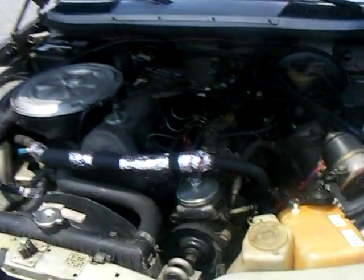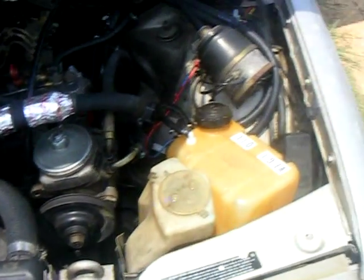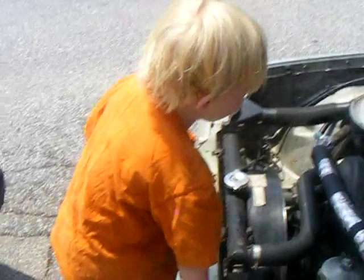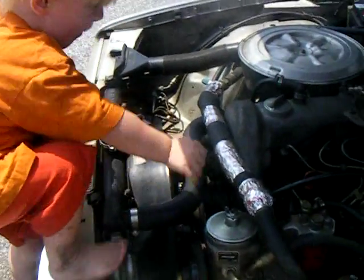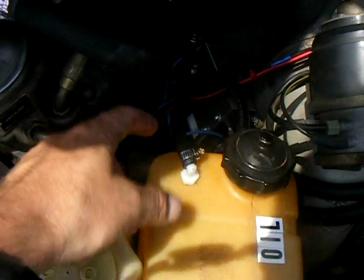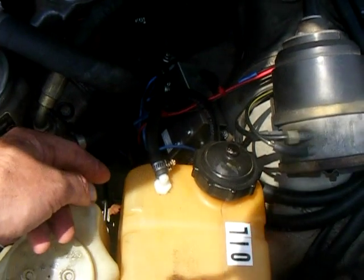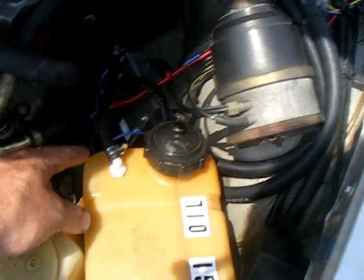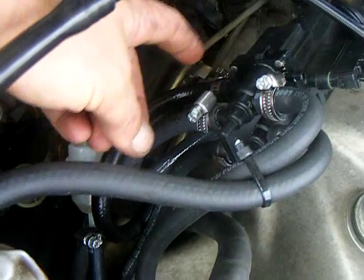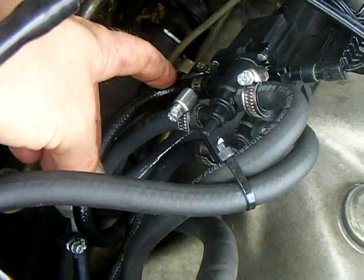I read a lot on YouTube and other pages about converting diesel to vegetable oil and it looks pretty simple. I'll show you details. I put a small tank from another vehicle that has vegetable oil in it. There's the vegetable oil tank — that is the return line and on the bottom is the fuel inlet. It goes to a fuel selector switch.